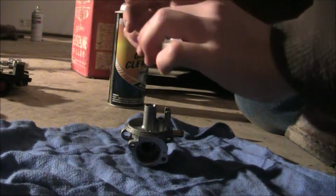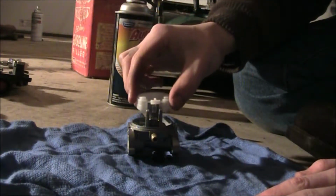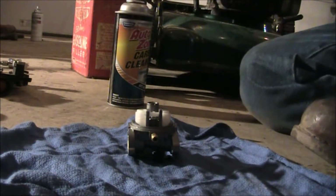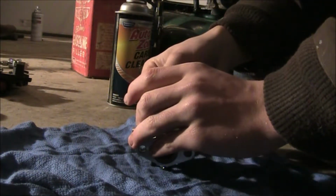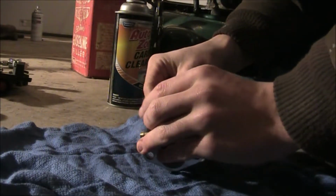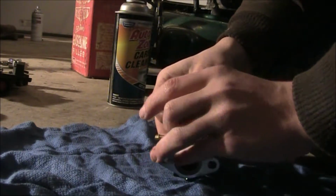And we're going to put the float needle right into its spot, rest it in there. Now, you're probably going to wonder how that stays in there, and that's where this rod comes in. Usually you just push them in or out. So you just line up the rod and the float and the holes and all that, and we're just going to stick it in there.